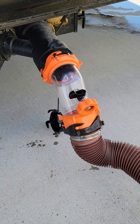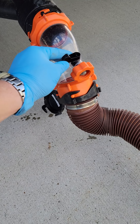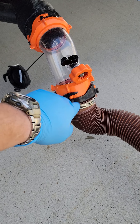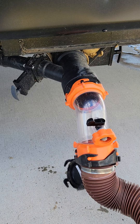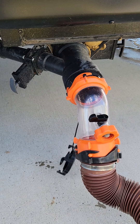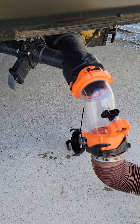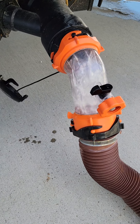When you're set up and ready to camp, you've got your sewer dump here. Make sure this stays closed — you don't ever want to open that, or else you'll have sewer and gray water come out. You should never open up the black or the gray tanks together, only one at a time. When you're camping and set up, you're going to be using the sink water a lot, so it's okay to open the gray just to let it continuously drain.